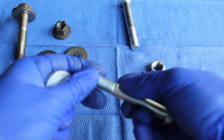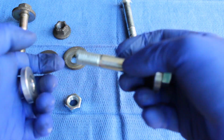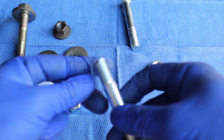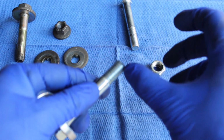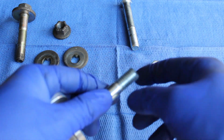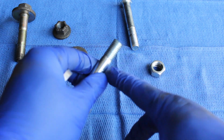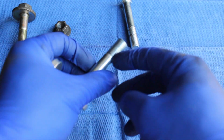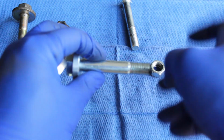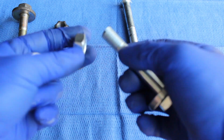Alright, so we are here at the last eccentric lockout bolt that we have to put in. I actually had to cut the bolt a little bit only because it was too long. I didn't want to have too much hang time. So we went ahead and cut it, modded it. The main thing is you want to make sure you have enough thread engagement for when you want to torque down the bolts, or the nut I should say.